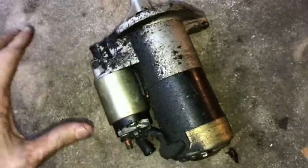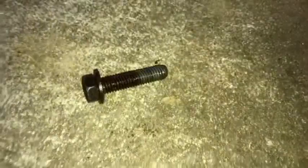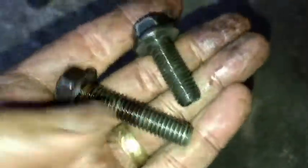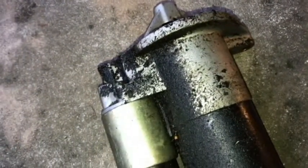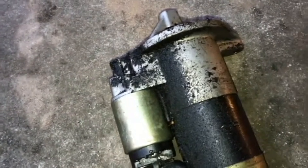I'm going to pick up a new starter and match it up. The bottom bolt is longer than the top bolt. The bottom one had a separate washer and the top one had it built on. So that's taking it off — let's go get a new one and put it on in reverse of how we took this off.